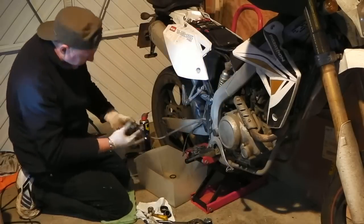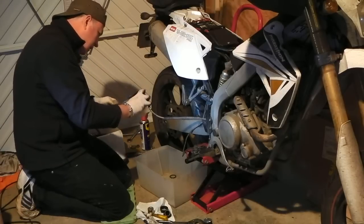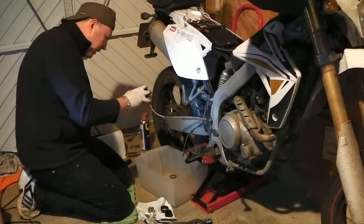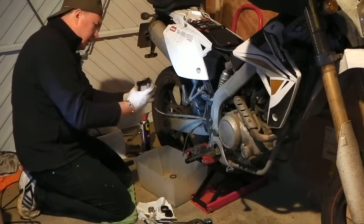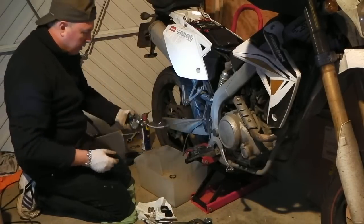Do you know what? I'm pumping the piston at you. It's starting to come out. I need something to block it off. So let's put this in, because otherwise all I'm going to do is pump the piston back out again. Right. We'll put that in there to replicate the brake disc, because it's pumping that piston out all the way.